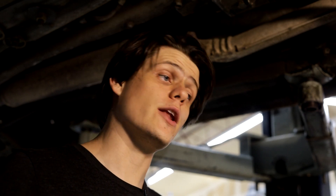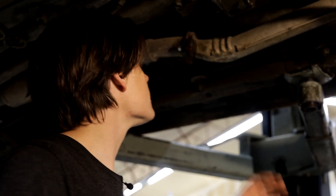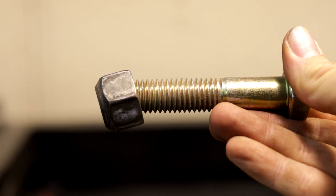It's good to tread lightly and take your time with these bolts, because breaking or stripping something will make the whole job take much longer than if you'd just been patient. When working with a bolt on an exhaust system, don't try to loosen it dry — a lot of times it breaks, and if it doesn't break, you'll round off the head. First, go in with a screwdriver and scrape off any excess rust or grime so the penetrating oil has easy access into the threads.